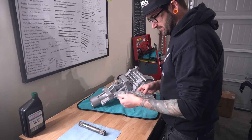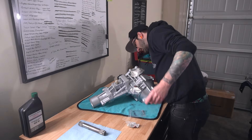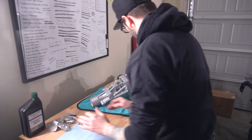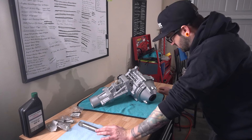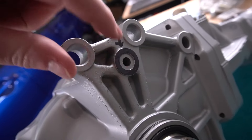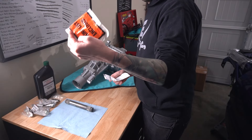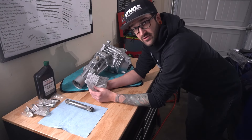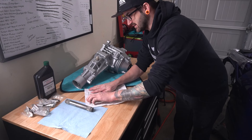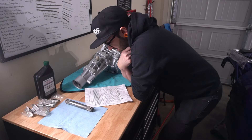We got all new hardware here. I'm gonna go through and make sure I have everything — one, two, three, four, five, six — we do have everything. New hardware goes right here. I like how they colored in this little section with the little arrows showing where the o-ring goes — it has to go right there or this thing will leak. This little guy cannot be lost or misplaced. Also inside the packing slip with the o-ring we have the filling and break-in procedures, so I do want to read this.